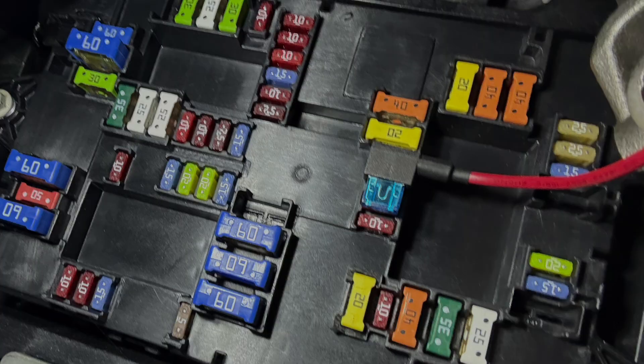There are no spares, so you definitely have to tap existing fuses. As you can see, I tapped one of the mini fuses on the driver's side — that powers my radar detector, camera, and a few other things. That one is switched. There are some switched and some unswitched options. I'll leave a few suggestions in the description, as well as some for the passenger side. You can also go back to the forums or Reddit for the full layout.